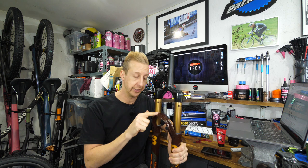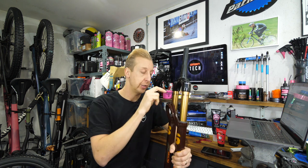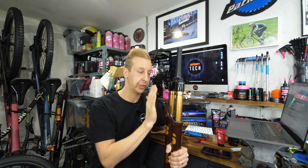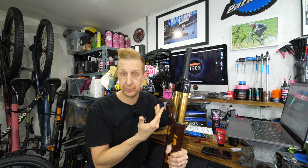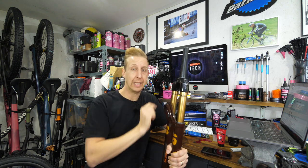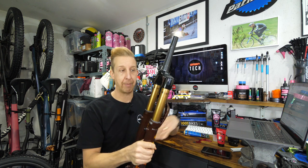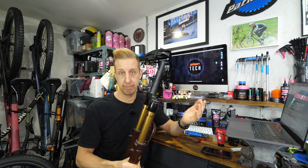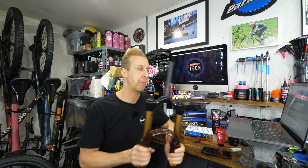Think how much this moves. Part of the design of this brace — on the older Fox braces they were more angular, but they've gone for a rounded design that sits forwards a bit more. Because we're changing the offset on the crowns, you're getting issues with clearances of the brace under full compression. You want to make sure this part doesn't contact the head tube of the bike. Some carbon bike head tubes are getting quite big now, so it'll clear fine. But with the reverse arch, because it's at the back, you're going to have a down tube there. Most bikes will be absolutely fine, but you could get some anomalies with bizarre-shaped down tubes — potential clearance issues. That could be a pro and a con.